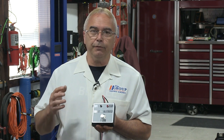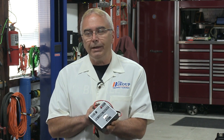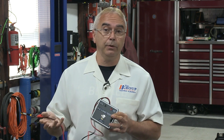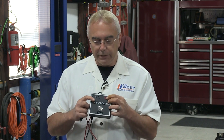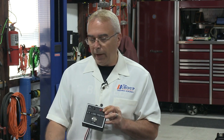Some manufacturers on the market have a combination charger and load tester for the entire battery pack. But again, we don't know which one is bad. We might have one bad cell. Since it's a Toyota and many manufacturers group two cells together and call them a block — are they both bad? Is only one bad? Can we get by with changing just one cell? This tool has a button that applies the load once hooked up, and the red and black jacks on top are where we put our voltmeter to get an overall battery voltage reading.